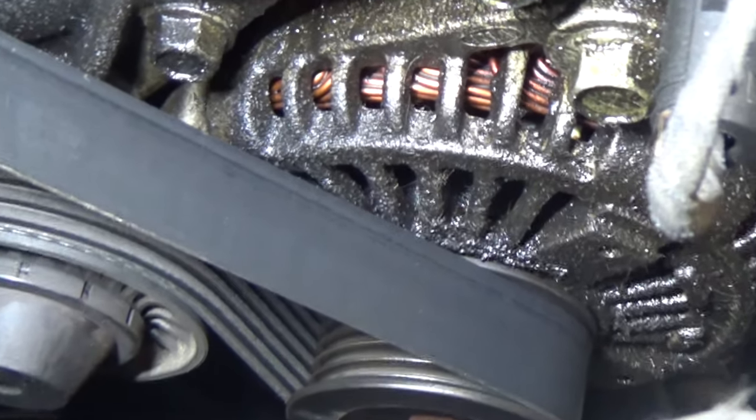When that oil seeps into the alternator, obviously that's not a good thing. Hey, I'm Glenn. Welcome to the All Stars Cars channel. Today's fun project — we got a leaker. I've got a Hyundai here with the 3.8 liter V6. It's a very common problem: the valve cover gasket leaks oil, runs down the cylinder head and onto the alternator, saturates it, and eventually your alternator burns out. I want to show you how to replace that gasket, prevent the alternator damage, and save some time and money.